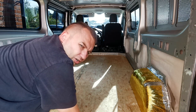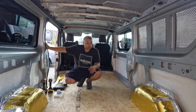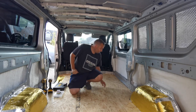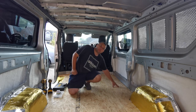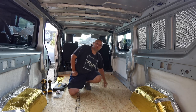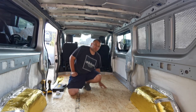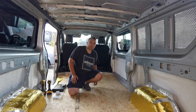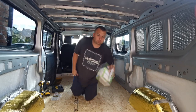I've got to say a thank you at the end of this video for little gifts I've had. So that's me screwed down now. I didn't have the right screws really so I did have to countersink them - there's a little hole there and I will just drop a little bit of filler over them. Just so if we come to lay a vinyl or lino in here we don't see them little holes. I'm not sure what route I'm going yet - if I'm going for lino, laminate flooring, or even a carpet. Who knows?